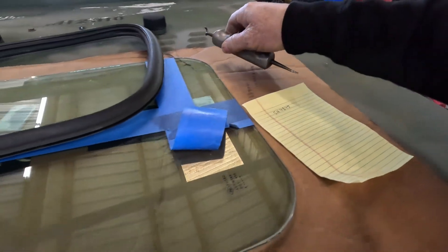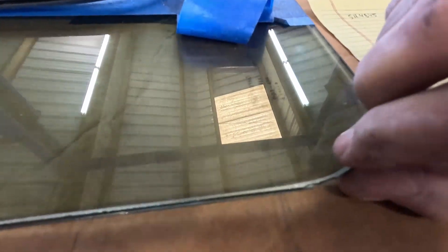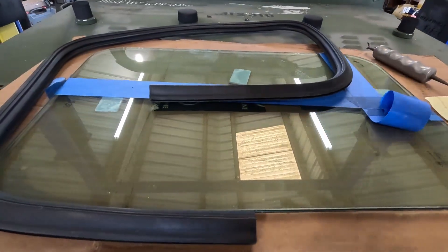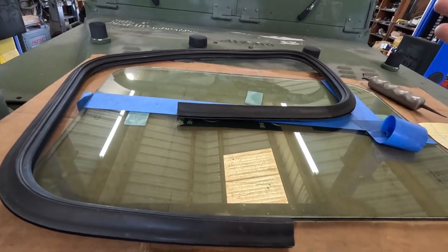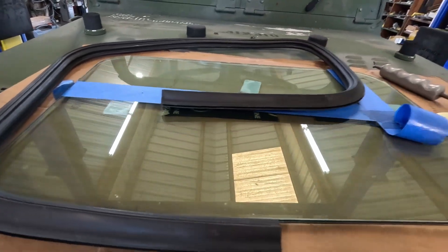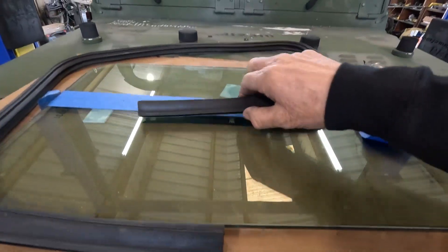Make sure you use safety glass — it's glued together, laminated, made for windshields. It's flat glass made for vehicles. You don't want something that's going to shatter if a rock hits it — you're going to get little fragments in your eyes. You don't want single-layer glass either; if it breaks you're going to have sharp shards that could cut you. This stuff stays together when it breaks because it's glued together.